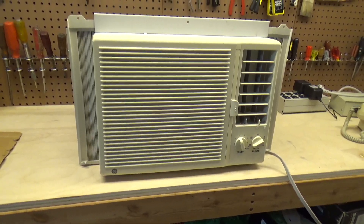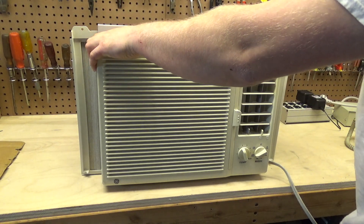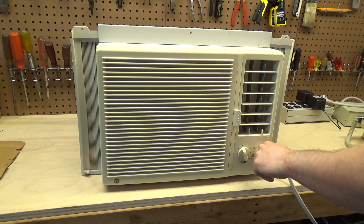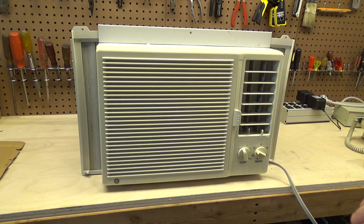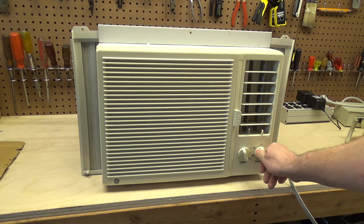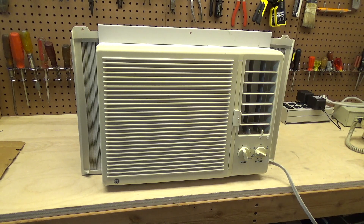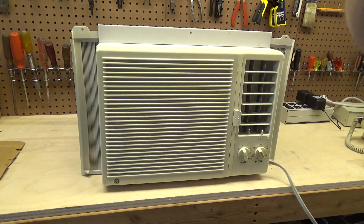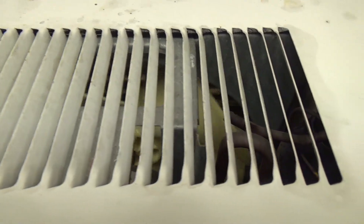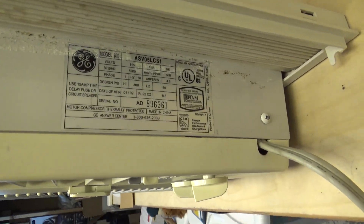Well, it's a cool setting but it's just the fan. And that is 0.44 amps. It's probably a PSC motor, I'm sure. It seems to be in pretty decent balance. Medium: 0.49 amps. And high: 0.51 amps. I don't feel a big difference — it seems like it's just more noise than anything else. I guess this is probably a ball bearing motor; yeah, with that spin-down it's got to be a ball bearing. These GE units from the early 2000s — good stuff. I don't know who made these things at the time, but they were solid.